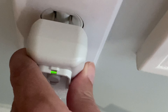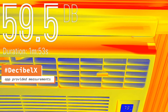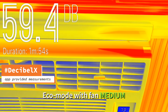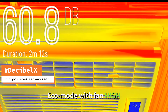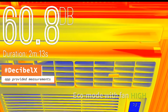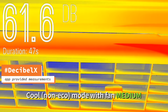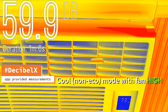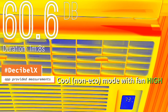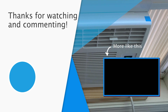For the sound check, I ran a few tests: the first three were in eco mode — fan low, fan medium, and fan high — and they didn't vary that much; fan speed didn't really change the sound level much. The next three were in cool mode where the compressor is definitely running. Overall you're seeing high 50s to low 60s decibels without a huge amount of change between settings, which is interesting. I will say that 60 decibels at night when you're trying to sleep is rather loud.